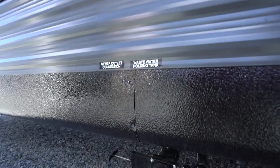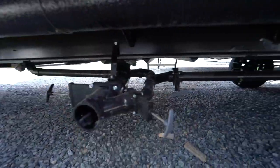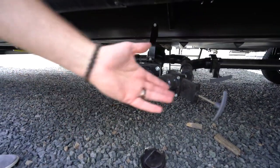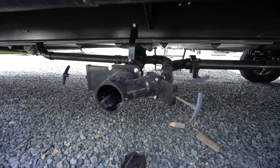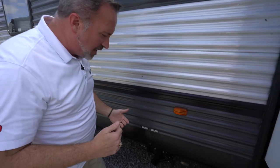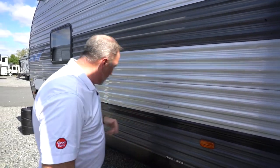Main terminations are located right there, indicated by the color of the handles — black for your black tank, gray for your gray tank. If you're hooked up at the campsite, you don't really need to keep them open all the time. Don't keep your black tank open all the time, because pyramiding can happen with solid waste that gets inside the black tank, making it extremely difficult to flush and causing inconsistent water flow. If you're going to clean these out, dump the black tank first and then dump the gray tank, so the water from the gray tanks can clean everything out as it goes.